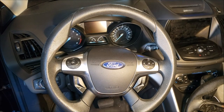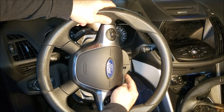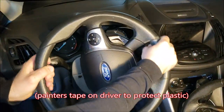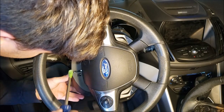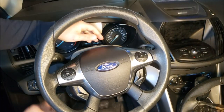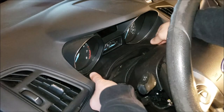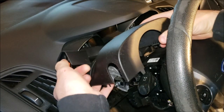We should now be able to remove the bottom cover once we pop off two snaps right behind your steering wheel. With our two screws out, we want to pull the bottom cover off. What we need to do first is turn our wheel 90 degrees to the right and release the snap on each side. Now this cover should just come off. The top should lift off as well — we can just take this panel and slide it out. That comes out pretty easily.